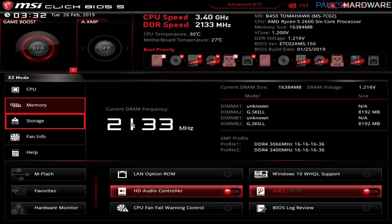When it comes to memory, it will automatically run at a default speed — for this platform that is 2133 MHz. Since you probably bought faster memory, you want to make sure the memory is running at the faster speed it's capable of. Assuming you bought Ryzen-compatible memory, you should be able to just enable XMP settings in order to get that up and running. MSI made a shortcut for it up here — it's just an on/off button. Now it's on. There are actually two XMP profiles for this memory kit: one is a slower speed of 3066, and one is a faster speed of 3400. I want the faster speed, so I'm going with profile two.